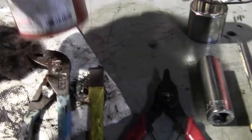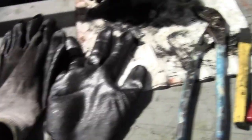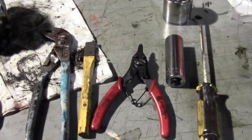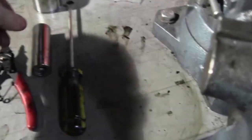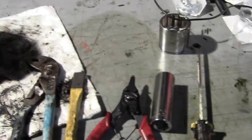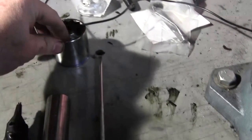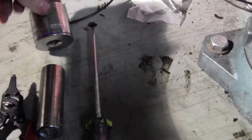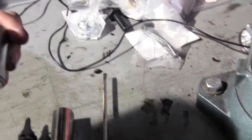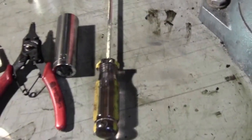It should be really good grease. Some of the tools that you're going to need: obviously eye protection, rubber gloves, a pair of pliers for the snap rings, a little chisel to get the end pieces off, snap ring pliers. I have a 20mm socket here. If the axle shaft is being stubborn we can pound it out, and if it's being stubborn coming back on, I have a 36mm socket from Cobalt, ready to go. And a screwdriver.